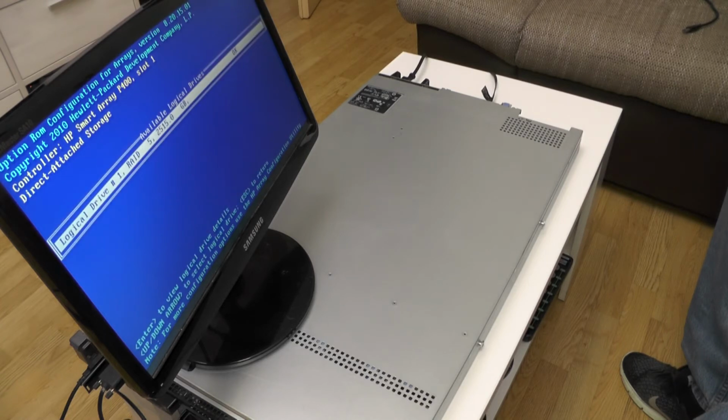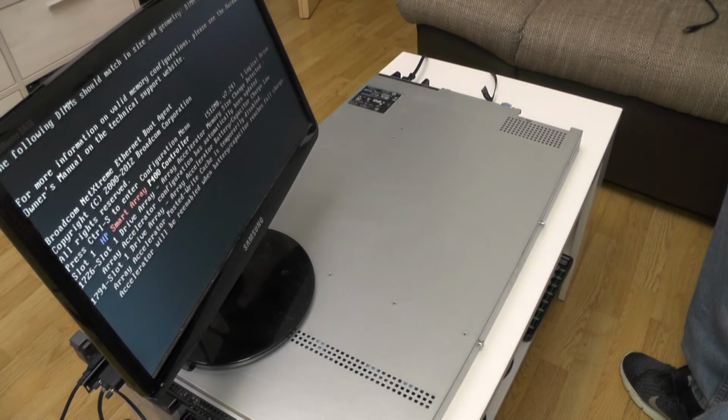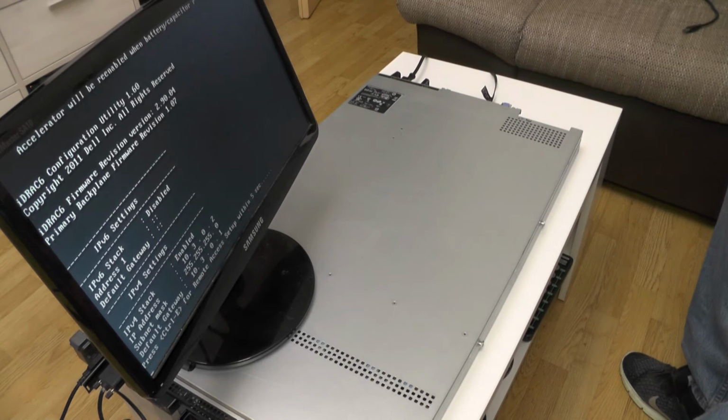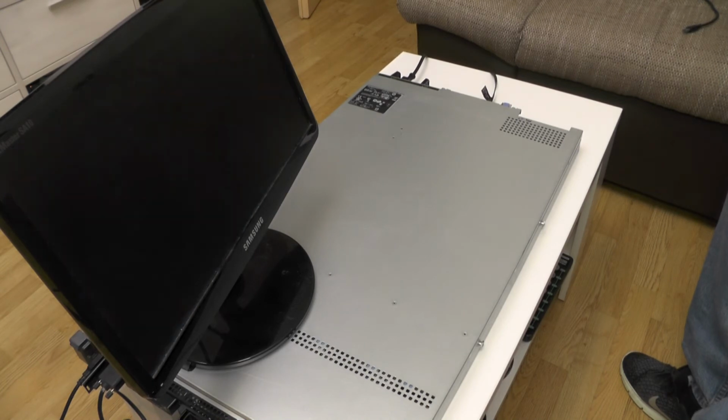View logical drive to verify that everything got created correctly. And we can actually boot. This is awesome. We don't need to reboot after we configured the RAID drive here. Oh yeah, and the battery is low, so it needs to be charged. This thing will resume normally when it's charged, about a day or so. Totally fine. So, Linux should boot now, and I'll give you the keyboard.